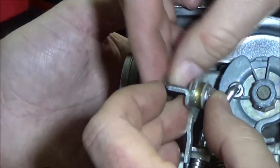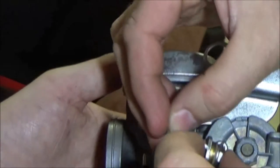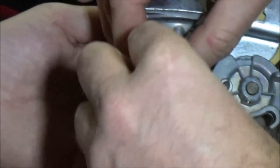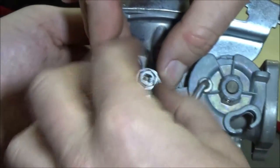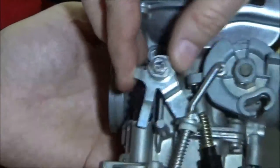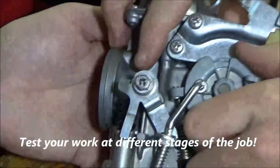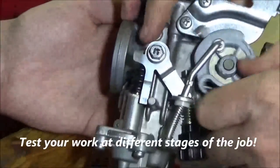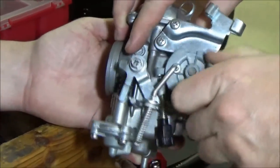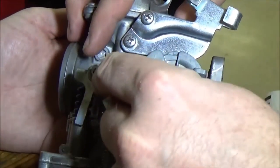So I just want to build this up correctly. I'm going to get this together — it has a lock washer, a split-ring washer, so you'd guess there's probably no Loctite on this. I'll take and set this in here loose. Here's the other thing every mechanic should know — not only use your parts fiche, but get this in just a loose fit first, and then test your work. Make sure that as you move this, it will operate on its own. If things are good there, then you can go ahead and tighten the bolt fully.